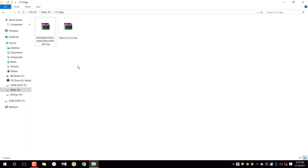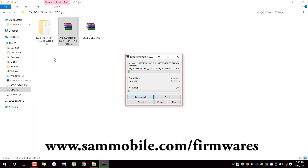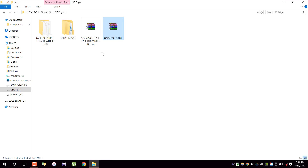Now leave your device to the side and head to your computer. Go to sammobile.com and download the latest firmware for your device — I'll leave a link in the description. After downloading, you'll get a zip file, which you need to extract. You also need to download Odin version 3.12.3, which is the latest at the moment — I'll leave a link for that as well.